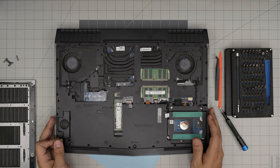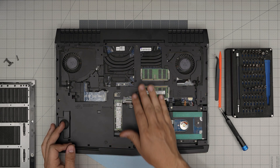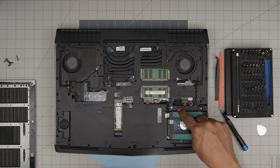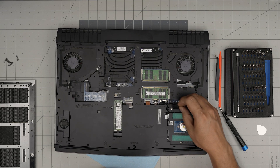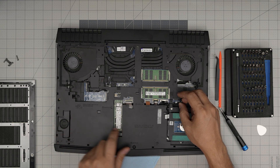Once you've done the sides and the back, grab it from there and lift it up, then pull toward the back to release the clips on the front end — those are the hooks. Down here we still don't see the battery; we see the storage, RAM, and heatsink. But I can see the battery label, and we can disconnect the cable right here.